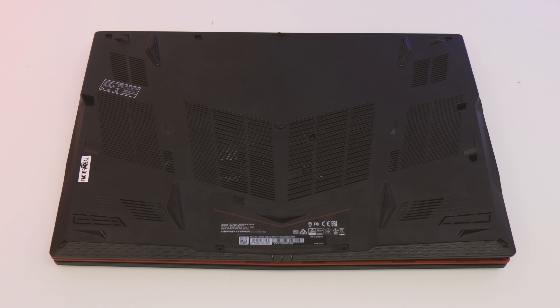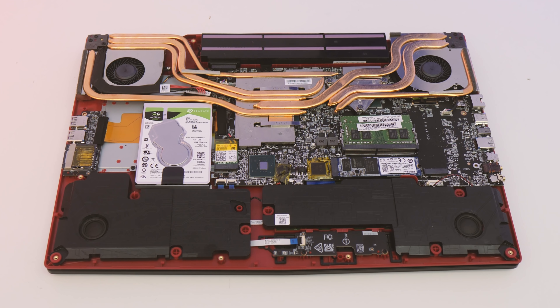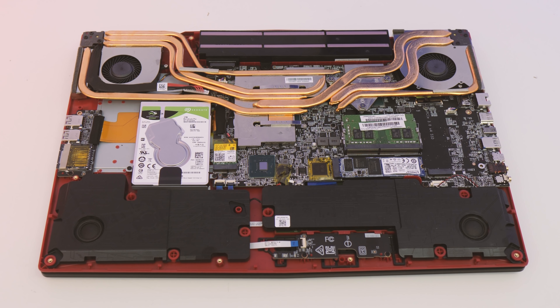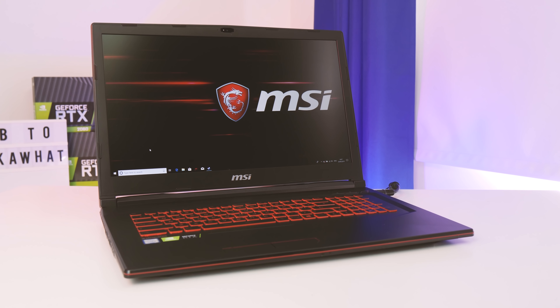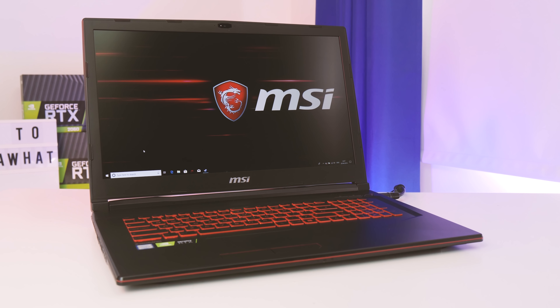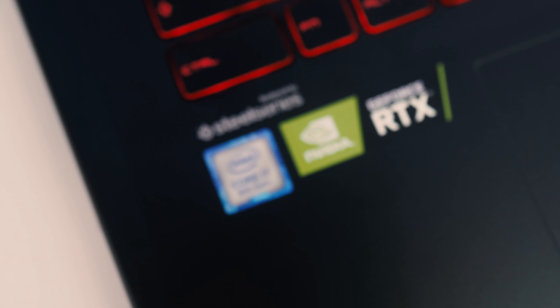This particular model also has 16GB of RAM with a 2666MHz clock speed, which for laptop RAM DIMMs is not too shabby. MSI have installed this in a dual-channel configuration, which gives a few more performance points and a bit more frame rate — on a small form factor, power-efficient machine that's really important. We've also got Intel 802.11ac Wi-Fi, and the range on that is pretty fantastic.